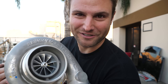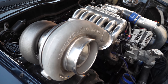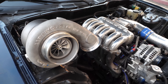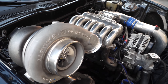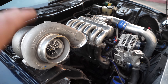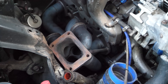So what do you guys think? Is my new child the right solution for this infamous three rotor, or did I go a little too small with the exhaust housing? Some of you are very well versed in this turbo already — I've got quite a few people who legitimately race and do some nasty things far beyond my ability. So if you know, let me know: is the GTX 4202 the right size, or did I go too small? Abel's opinion — too small, by far too small. But what we're looking for is to make this car 850 to 900 horsepower to the wheels with the best boost response possible.